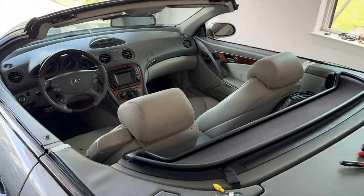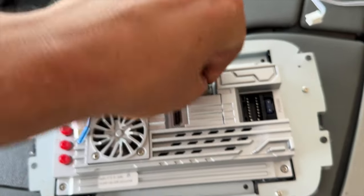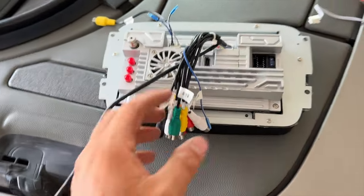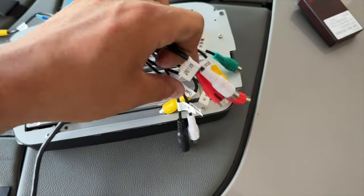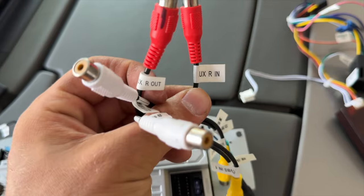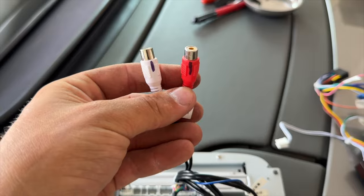The decoder is the major key point here. The big wiring harness gets confusing because it doesn't come with instructions. I went back and forth with customer service for a very long time and they were of zero help. I marked everything out — you can do this too. A lot of these you don't need unless you have a secondary amp. There are two red and two white connectors; the ones that say 'auxiliary right in' we don't use. We're only going to use auxiliary left out and auxiliary right out — I've marked the tops so I don't get confused when reinstalling.